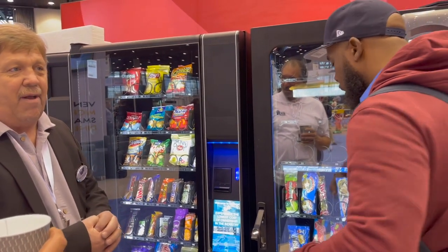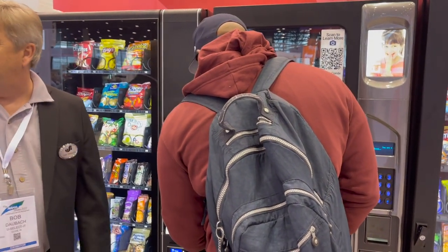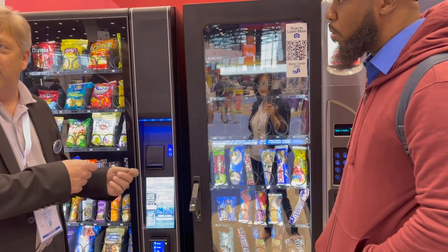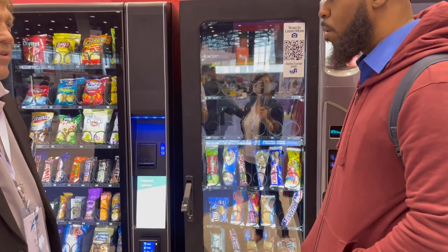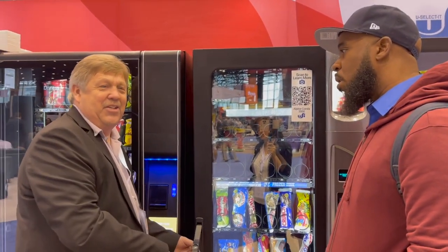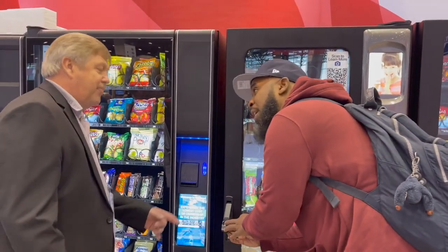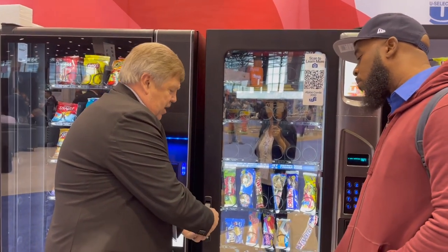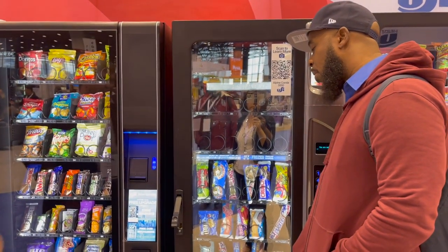We actually sell a little piece of metal you can put in there. And you know the key set locks? If guys use key sets that are too short, you have to put that in behind the key set, or every time you open it, the key will spin in a circle. That's what yours is doing, it's spinning in a circle. It's not snapping up because it isn't locking in. So this little piece keeps it in place. When you unlock it and go back, it's not sliding back in, it's snapping up. So you put that in there to lock.